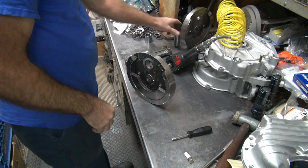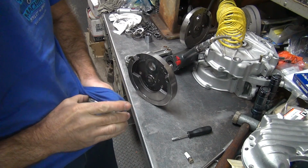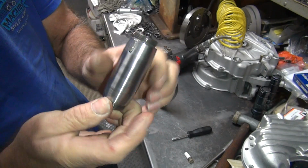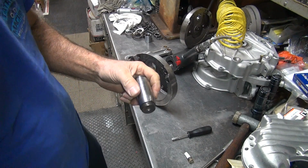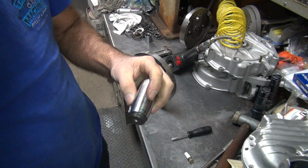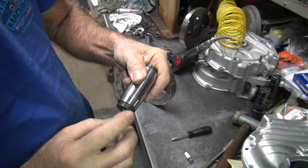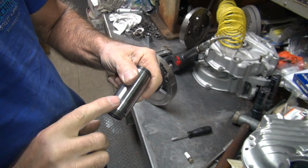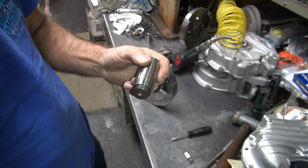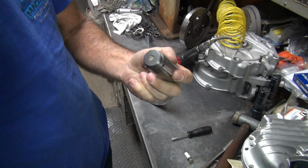Okay, crank pin right here. So we're using Excel crank pin. Those are the best ones made ever. They're made out of bearing steel. Same stuff rollers are made out of. And they got good machining. And the threads are all ground and not cut. All that good stuff. It's just they don't make them anymore.